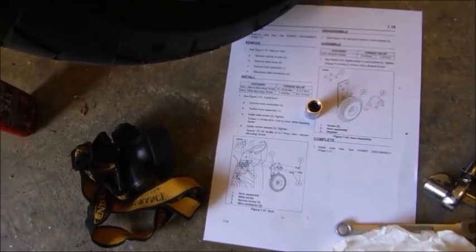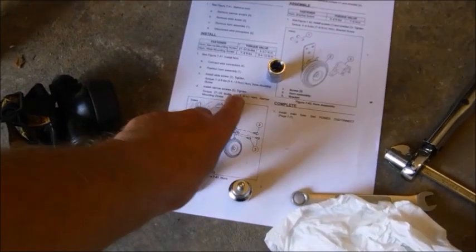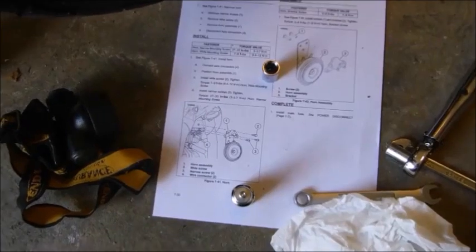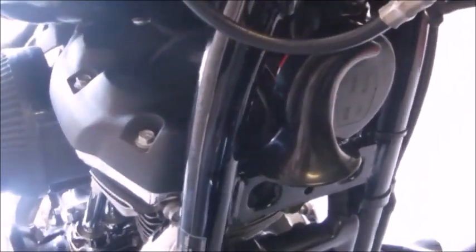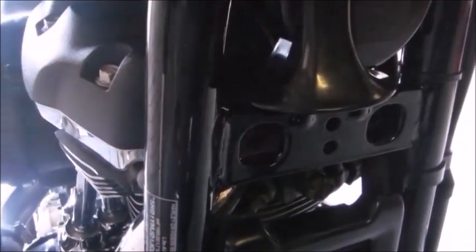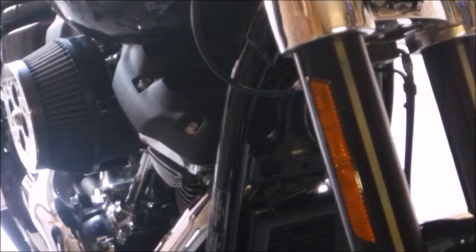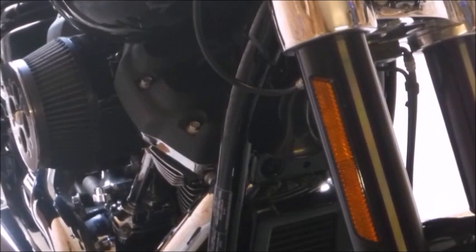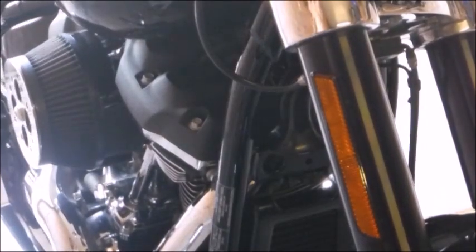So the next one, the main bolt to tighten up, 3/8 inch — we're putting that to 7 to 9 foot pounds, or 9.4 to 12 Newton meters. As my big torque wrench is in Newton meters, that's what we shall go for. So we know it's hard to see it under there, but all back in place, all rock solid. All the bolts done up per torque as specified. Definitely louder than it was before — just to show it does still work now it's all wired in and bolted back in place. Definitely louder than the OEM.